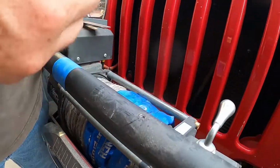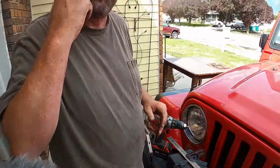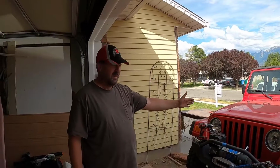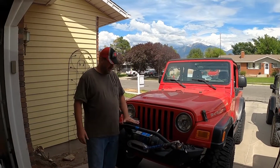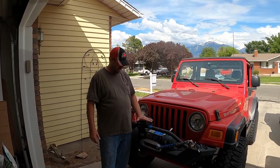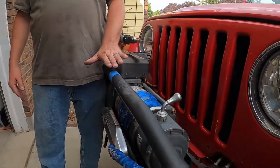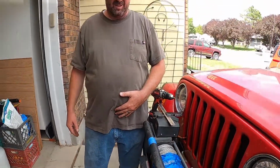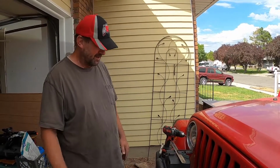So I want anyone who can tell me what I just did wrong to tell me what I just did wrong. Pause the video, leave a comment, see if you can figure out what it was I did. The Jeep is sitting on a slight incline in the driveway, but I found the level center line this way. So my brackets are going to be angled down when the Jeep is sitting level. I just thought about it as I was drilling that second hole. But that's okay. Luckily the lights are adjustable, so we'll just fix it in the lights.